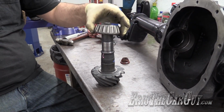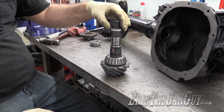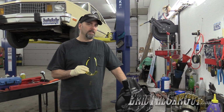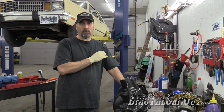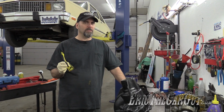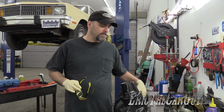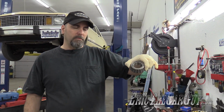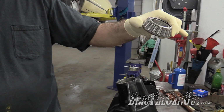Shim, practice bearing, and crush sleeve. This is actually the second version of this video, and the reason is that I ran into some difficulty and got some really great help from the people at King's Ford here in Cincinnati, and also the Ford Performance Tech line. Oddly, both of those guys were named Steve. Anyway, there was something that I did in the disassembly part of this video series, in that I took the old pinion head bearing and I hollowed it out in order to make it a setup bearing for this whole process.